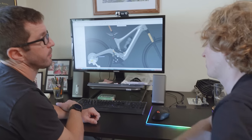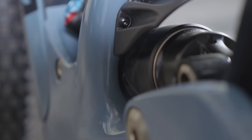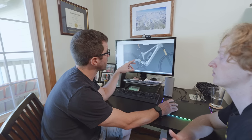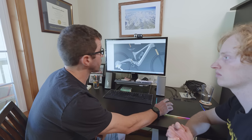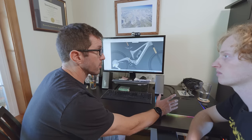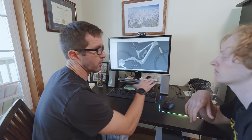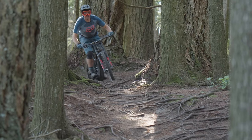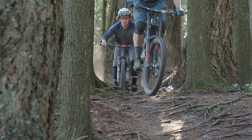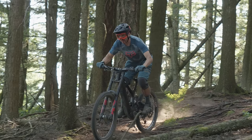This bike is fully approved to run coil shock options. There are limitations because the seat post nestles right in the crux of the shock, so the piggyback can't be too long. We built a hack into the suspension where the shock stroke is 60 millimeters — a 205×60 shock — which puts you at 155mm rear travel. If you do a 65mm stroke, just change the stroke on the rear shock, you can get 170mm rear travel. We're not going to sell it like that, but it's totally approved. It'll also fit a dual crown fork — 180 or 190mm. I run a 190 in the front and 170 in the back with a dual crown, and that's totally approved. The frame is strong enough and everything clears for that long-travel option.